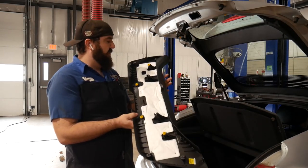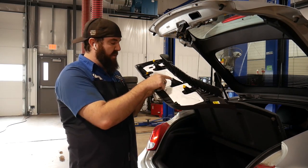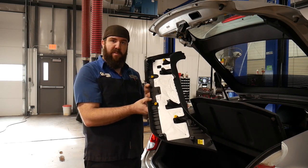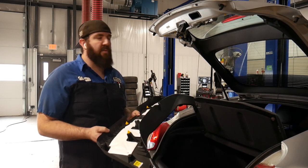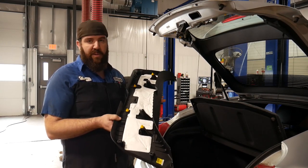When we took the panel off this Veloster, as you can see, some of our clips came out and pulled from the panel, broke in half. But this is normal for most interior panels. A lot of guys will say, 'Oh there's four clips left, throw it back in, it'll hold.' No — we don't like to do it that way. We need to replace these clips.